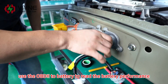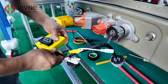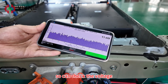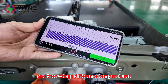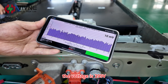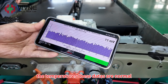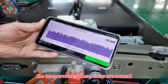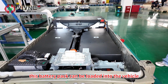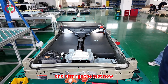Use the OBD2 to read the battery performance now. As we are using a testing BMS only, we can check the voltage and voltage difference and temperatures. The voltage is 399 volts, voltage difference is 11 millivolts — these data are normal. Now all the assembly has been completed. This battery pack can be loaded into the vehicle and arranged for testing.